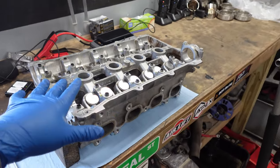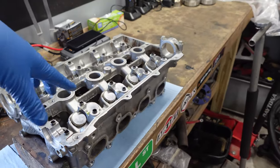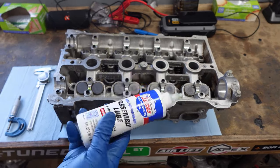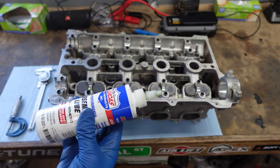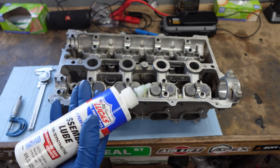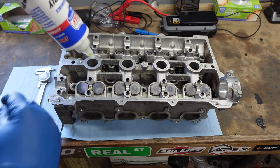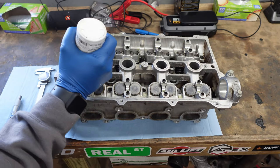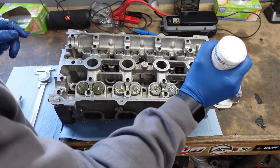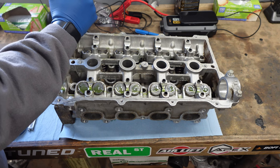I'm going to show it to you on the table — it's the same exact process. Next up, let's lubricate. We're going to put some assembly lube all the way down and then lubricate the cams. For assembly lube — not sponsored — I really like this stuff from Lucas. It's super tacky and stays, so if you're building an engine that's going to sit for a bit, it will stay. I've had good luck with Redline assembly lube as well, but I like that the Lucas comes in a squirty bottle. I'm just going to shake it and apply it to every lobe.